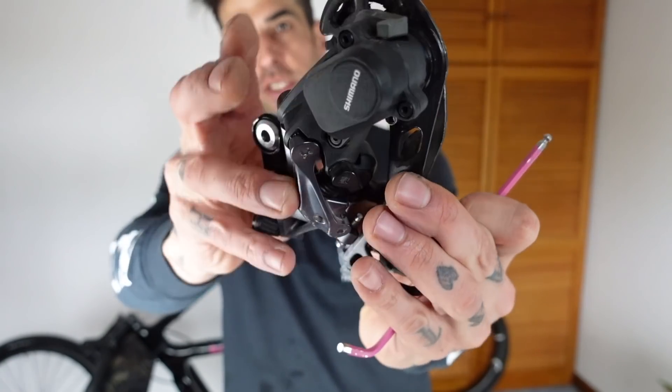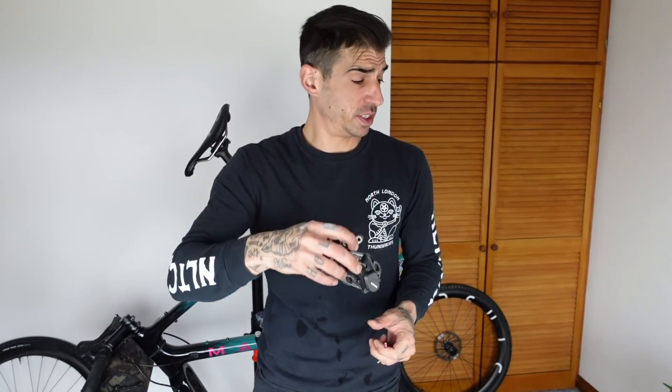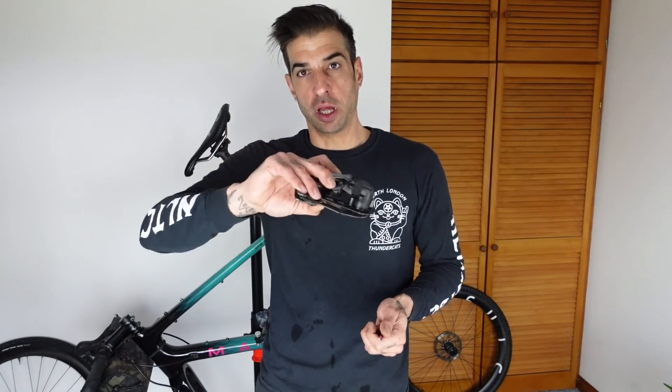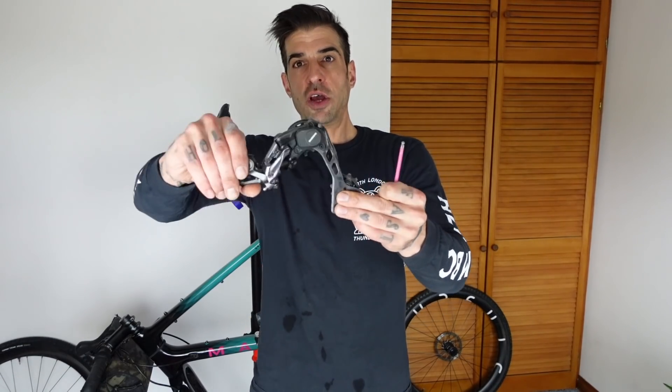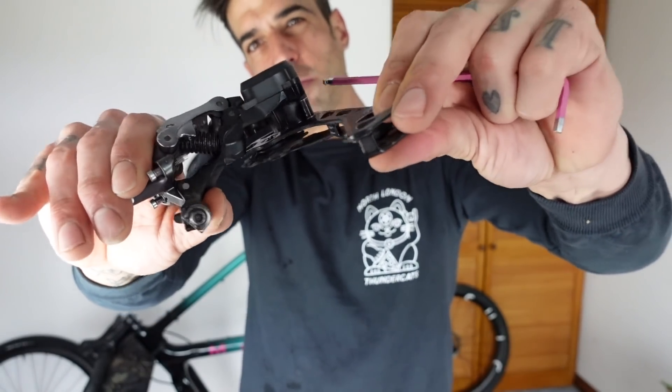Honestly, I gave it a really quick clean — totally, totally worth doing, I can't stress it enough. Regular viewers will know there are a lot of bike builds on this channel and honestly I'd love brand new components for every build, but we don't all have that. So if you're riding in winter and it's getting towards nicer weather like now with spring, take your rear mech off, give it a good clean, oil the moving parts — just a little dab of oil on all the little moving parts and it will keep your bike running smoothly for ages.